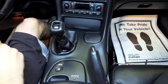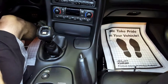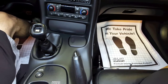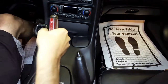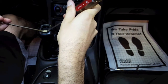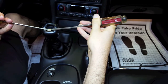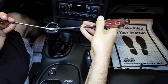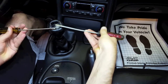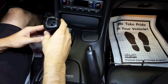Setting it to the side and moving on to removing the knob. Removing the knob is pretty straightforward. There is a T-shaped insert in here that keeps it in place. Using two flathead screwdrivers, you can pry it out very gently. You want to do it slowly, and you pry against the knob. It will not damage the knob if you're careful. If you pry it up, it will just pop out, and like all things leather, it will go back to its shape again.